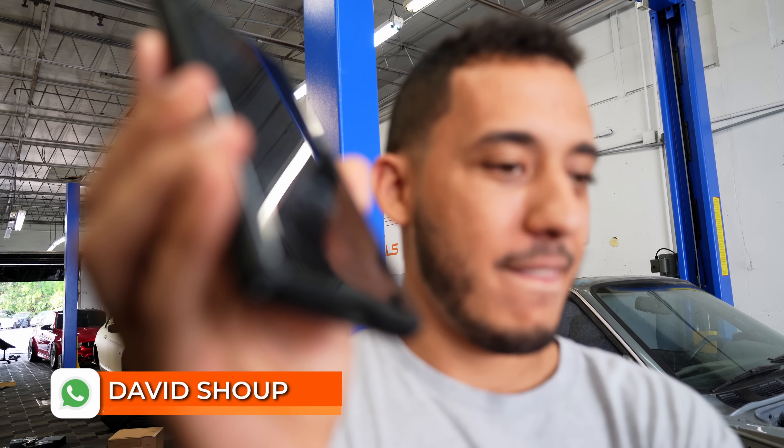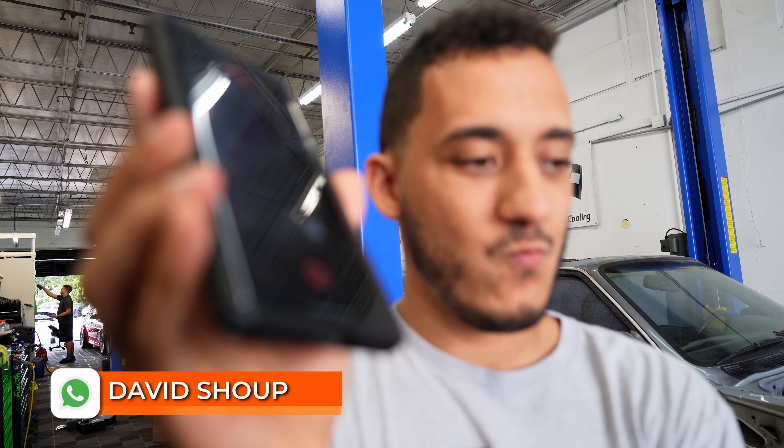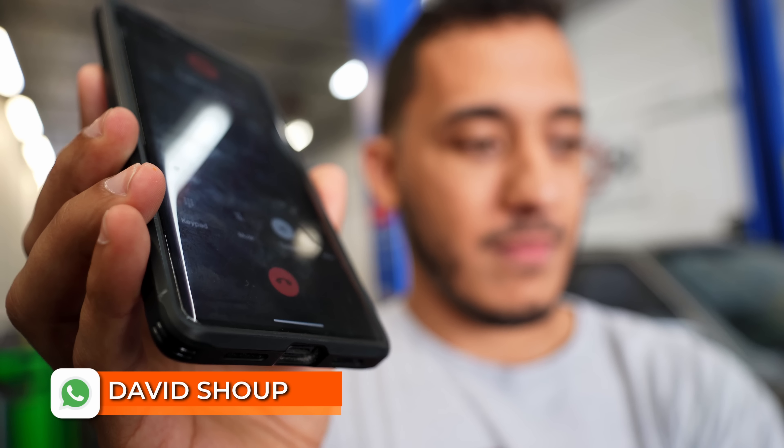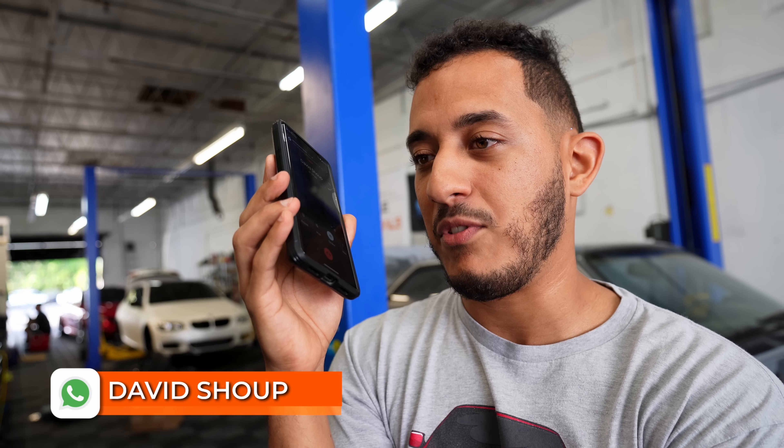Thanks for putting me on the spot. Basically the general gist of it is the O2 sensors are never designed to be in the manifold — they're designed to be in the downpipe. What ends up happening is when you put an O2 sensor that close, it's exposed to a lot more heat and a lot more pressure. Over time, you can drastically decrease the lifespan of the O2 sensor and also throw off the way that it actually reads lambda. What you want to do is move the O2 sensors into the downpipe. Since we only have one turbo and one downpipe, it doesn't make sense to use four sensors. After a lot of hard work and testing, they were able to devise the logic that allowed us to cut it down to just a secondary on bank one. You just run two sensors — a primary and a secondary — and plug the manifold holes up and live happily ever after.